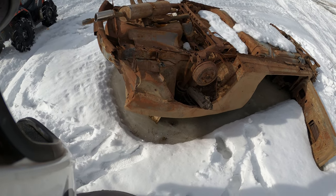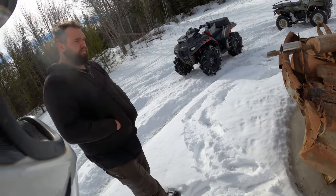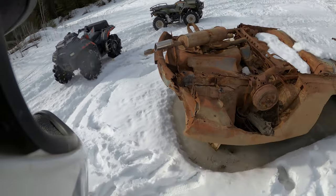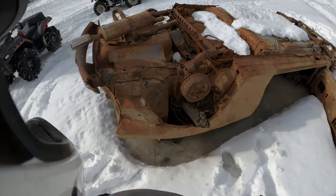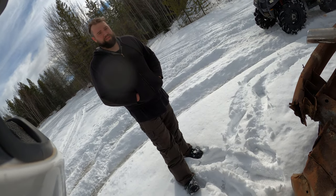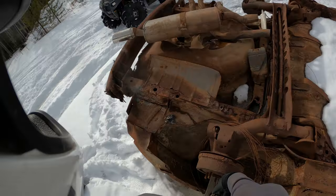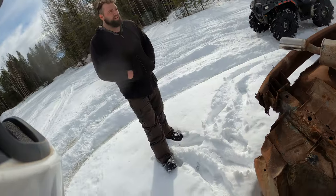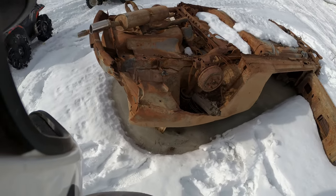Oh, no. Your first instinct was correct. I missed the obvious thing here. This is a J body. You know how I know? Strut with a coilover spring. No. J bodies had that. The Delta bodies had the spring between the swing arm and the body. Gotcha. I'm not sure how I missed that.